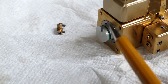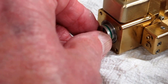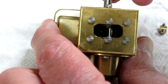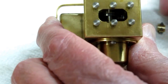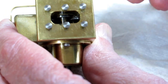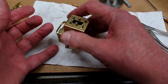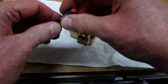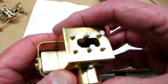I take the lower end off of the connecting rod, put a little oil around it, put a new piston ring on there, and then push the piston back in gently with oil on it. Then you engage the connecting rod with the crank pin and push up on the piston until the crankshaft rotates to bottom dead center. Then gently reach in there and reinstall the end on the connecting rod — it's a little tedious but you can do it. You can reach up in there with your little finger to hold the piston up, or use the end of a small wrench and push it up while holding the connecting rod against the crank pin.